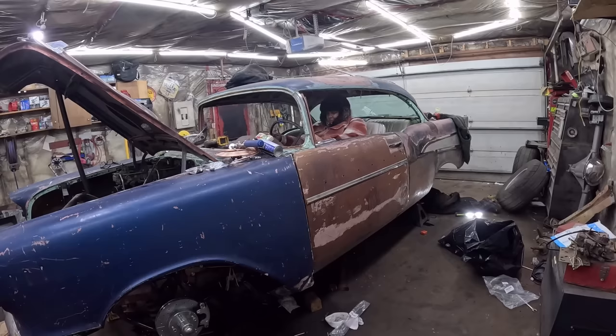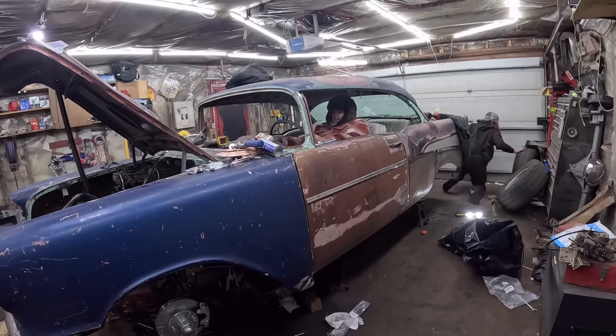Just keep doing that. Sounds like there's something happening. Oh, yeah, hey, we got brake fluid back here. Keep going. I didn't see any leaks yet. There's definitely like a force against it. Yeah, that'll happen. Hang on here. Can I hold it? Yeah, you might as well just hold it down while I slap this bleeder. Actually, he's got fluid back there, so that's good. So we filled the line all the way to the back.